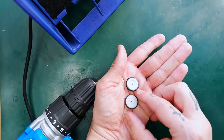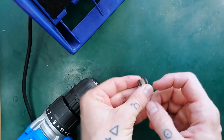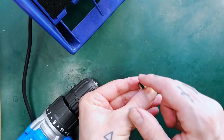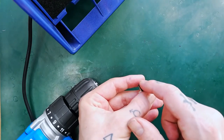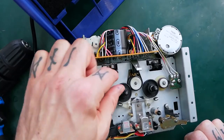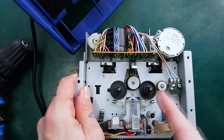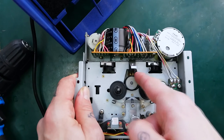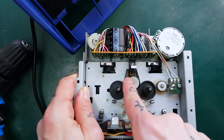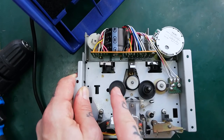So I hope you can see that those are smaller now — the same size as each other and even all the way round. And you can see that it's now a matte surface where it was gloss — that's good, that's going to grip against the side of the supply and take-up reels. Now I've reinstalled them into the transport and you can see that although there's maybe less clearance between play, fast forward, and rewind mode than with commercially produced idler tyres, it's sufficient to give clearance between the two reels and differentiation between the two modes.